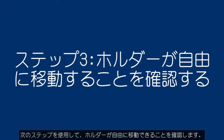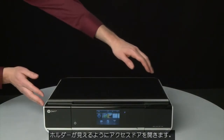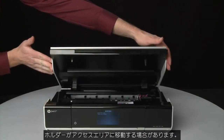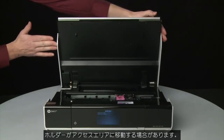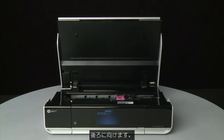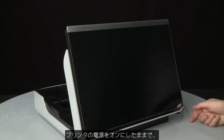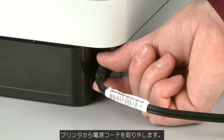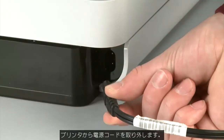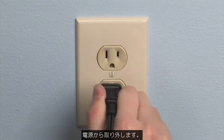Use the following steps to make sure the carriage can move freely. The printer must still be powered on for these steps to work. Open the access door so that you can view the carriage — it might try and move into the access area; if it does, allow it to move into that position. Turn to the back. While the printer is still powered on, disconnect the power cord from the printer, then disconnect the other end of the power cord from its power source.